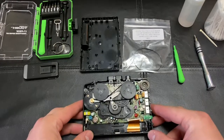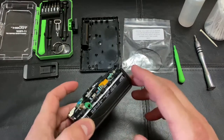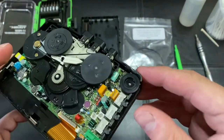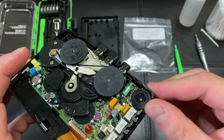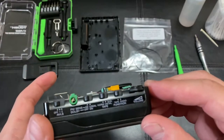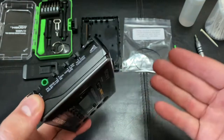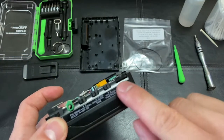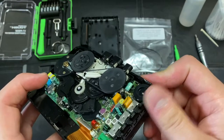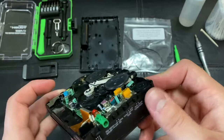A common problem is the tape doesn't work, but a few other things too — like the volume wheel gets really scratchy, or there'll be zones where it goes to mono. There might be a way to clean it while it's like this, but what I do is have it either unplugged or with no battery, spray some rubbing alcohol, and then work the wheel back and forth a bunch of times. Not aggressively — that usually fixes it.